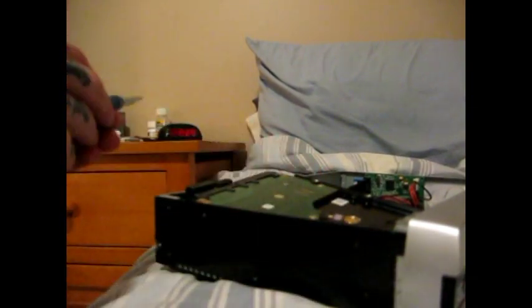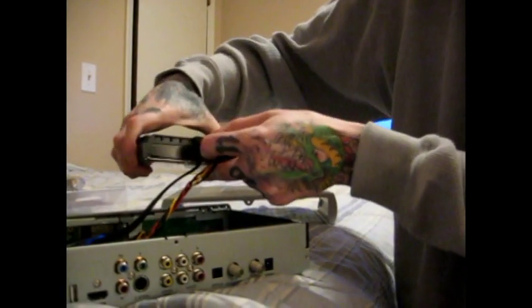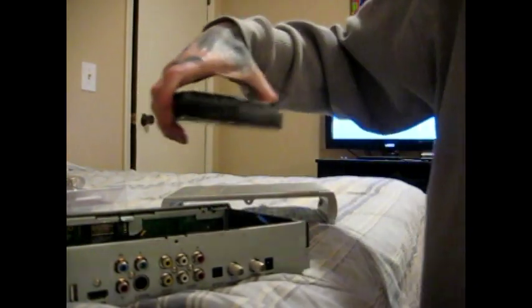Three. The hard drive will just kind of lay there, because once those screws are out, it's just laying there basically. So you lift it up, pull out the SATA cable and the power cable from the back, and you just lift straight backwards with these, and then that drive is out. You can set that aside, that way if you ever need to return the DVR, you want to keep the original hard drive, that way you can put it back in there and you won't get in trouble that way. Then you grab your new hard drive, take it out of the package,